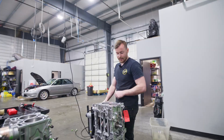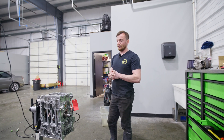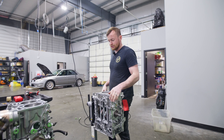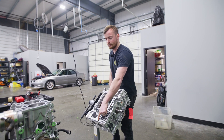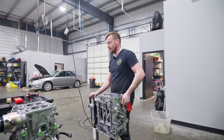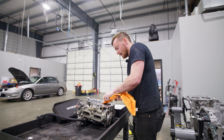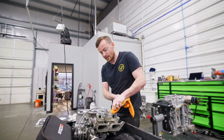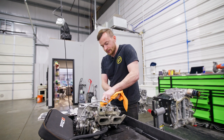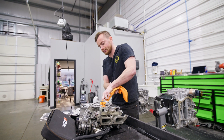We shipped it back, got two new case halves remachined, new inserts installed, and it's on my stand now for reassembly. We shone a light through the hole that was leaking before just to make sure we're good — no problems there. Considering this car only had five to ten minutes of idle time on it, I'm just going to clean up the heads, stick them back on since they're already machined flat and drilled to half-inch head studs.